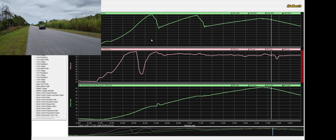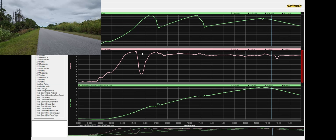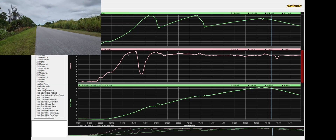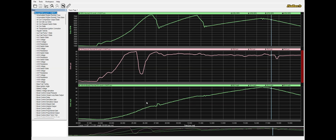Now this is the same exact car, except we're on the road doing a first gear to third gear pull. We're easing into first gear — if you launch, this gets a little worse. So this is oil pressure here. This is going to be first gear ramp up, second gear, third gear, and you can see road speed constantly increasing. Right before 5500 RPM we were making about the right oil pressure — 85 PSI — and then all of a sudden our oil pressure cuts in half. This is the byproduct of there not being enough oil in the sump for the oil pump to pick up. That oil is hanging out in the head somewhere, and because the car is accelerating a lot faster than the oil is, it's hanging out behind the pan, behind the head, and it simply can't make it down into the sump fast enough.